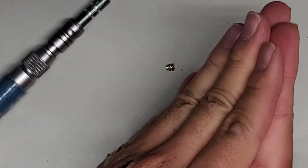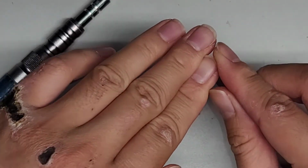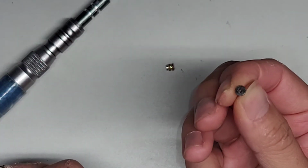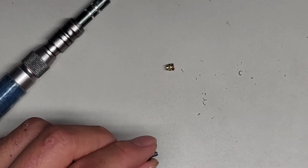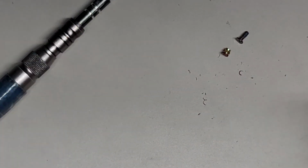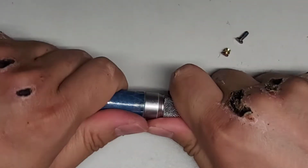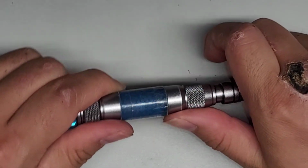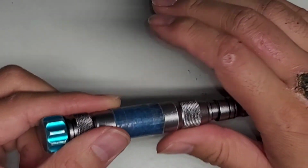opening and closing, that prying force rocks the screw slightly side to side like this, and over time that loosens the screw and it will slowly twist its way out. And then once you get a loose fit, you can imagine it like, let's say I'm holding the screwdriver here. If I'm holding it like this and I try to rotate it, it's very tough. But if I open this gap and now I do it, it's basically prying my thumb off.